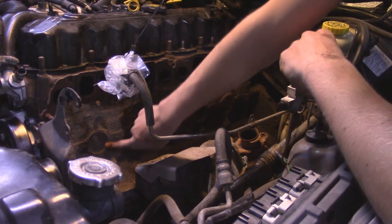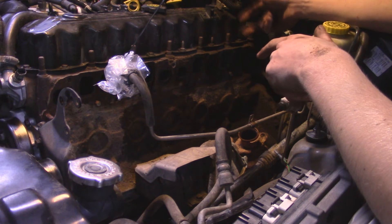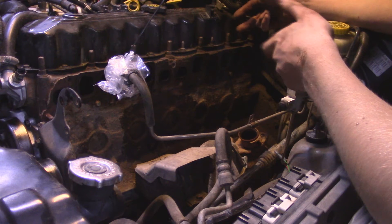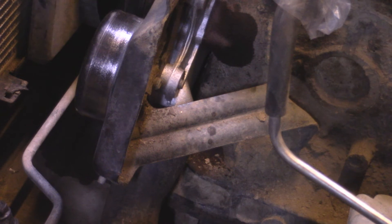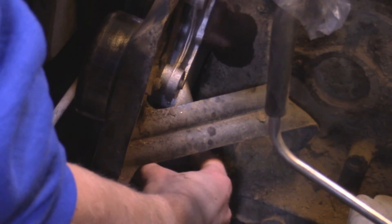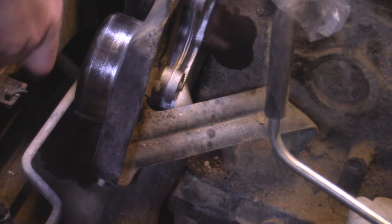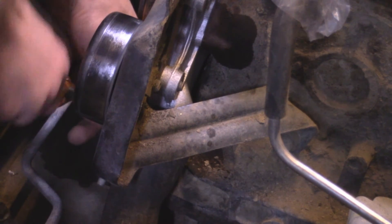I got these two bottom bolts out that go down to the collector, and then I took this last nut off for this half of the header. Now you can see all five freeze plugs on the side of the engine. There's actually going to be one on the back of the engine and one on the back of the cylinder head — those two you can't replace when the engine is in the vehicle. If those start leaking, you're probably going to have to pull the engine out. Before we remove the freeze plugs, we have to drain the coolant system. The easiest way is to remove the lower radiator hose from the water pump — make sure you have some buckets underneath to catch the coolant because there will be a lot coming out.